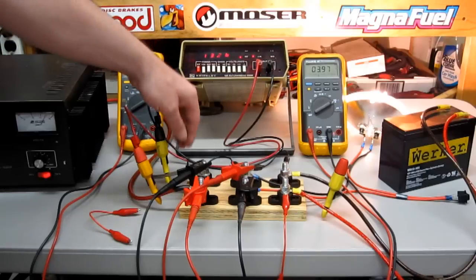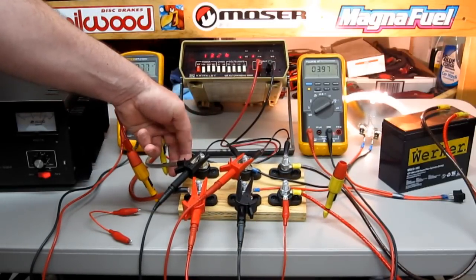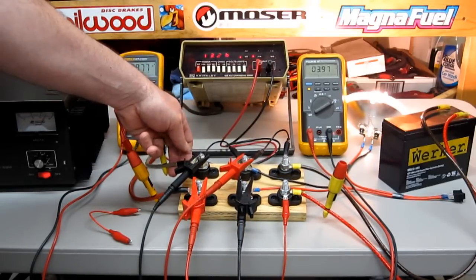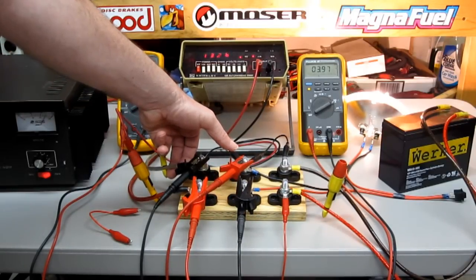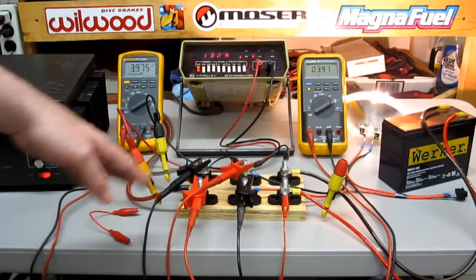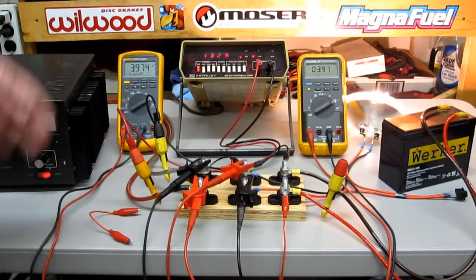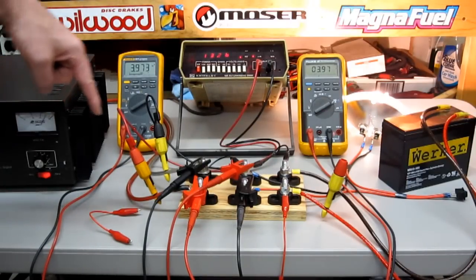If we turn our headlight on, you can see that those numbers are the same. We have approximately 4 amps flowing from the power supply to the headlight, and approximately 4 amps returning from the headlight back through the power supply to its negative terminal. Since those are redundant, we really don't need to monitor current at both locations. Kirchhoff's law says this has to happen — and now we've proved it. Both DMMs indicate positive current flow in the same direction.